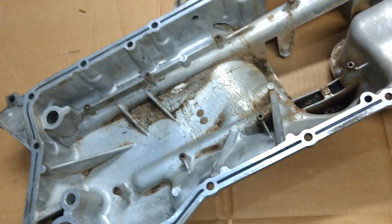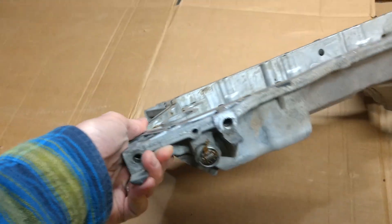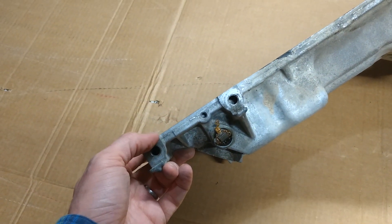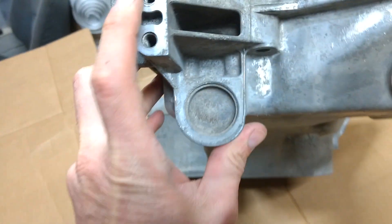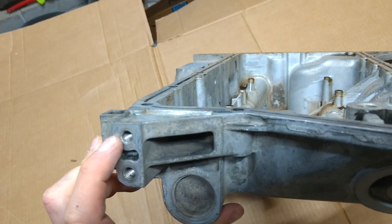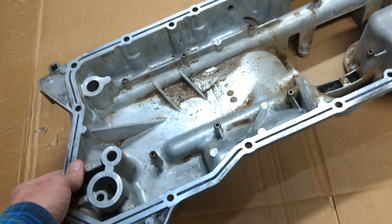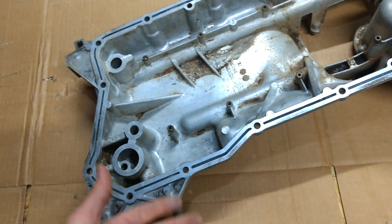At the front you have your dipstick. On this side are the lower mounting points for the AC compressor — I can't remember if the compressor itself bolts directly or the bracket does. These two bolt holes here are where the alternator bracket bolts on, so then you can mount your alternator. Not even talking about holding oil — your oil pan is holding your alternator. So it gets really tedious, and if you're doing an AC swap setup, you have all of this to contend with or add to a full aftermarket oil pan.